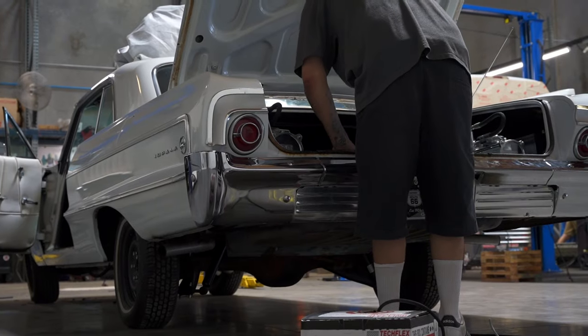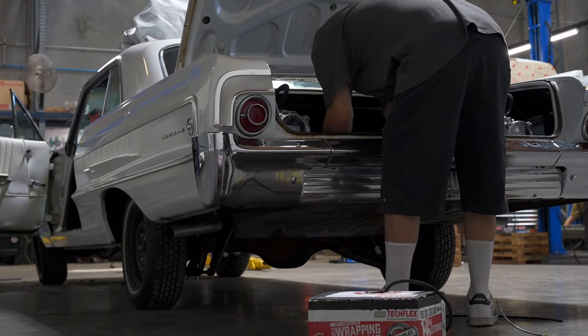The main reason the hopper guys don't do this setup is because when they catch on fire you don't want to open the trunk — it's not as quick. But you can still hit the trunk with your key and grab it real quick. The front pump will have all four batteries powering it; the rear one will only have two. The guys with 16 batteries — 16 times 12V, that's high voltage — you don't want to be in that trunk when it catches fire.